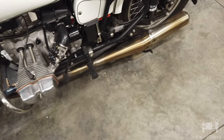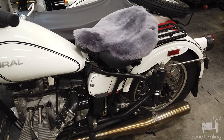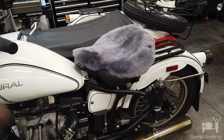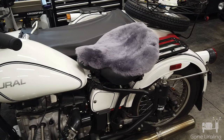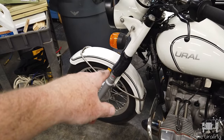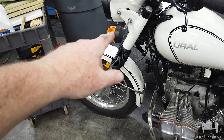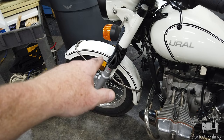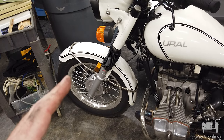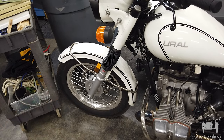I've got 1,000 miles on the new rebuilt final drive already — we went over and did some traveling. You may have noticed I have a new sheepskin seat cover; I'll try to do a video on that and tell you why I stopped using my old one, provided I still like this one. I literally have 30 miles on the sheepskin, so I don't have an opinion on it yet, other than my initial opinion is it's comfortable. The 15W fork oil is nice — 390 milliliters per fork. I used 15-weight Motul fork oil, which is a bump up from the 10-weight that came in it originally. It firmed the front end just a little bit, but the 10 did feel a little soft to me, so I think I'm going to stick with 15W.